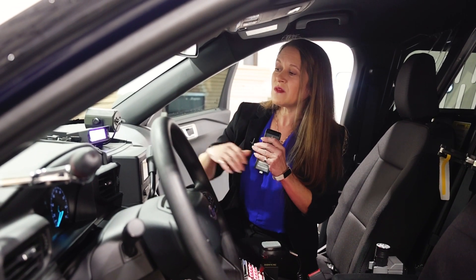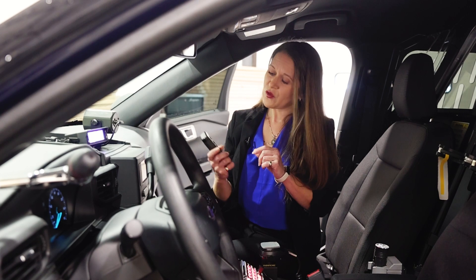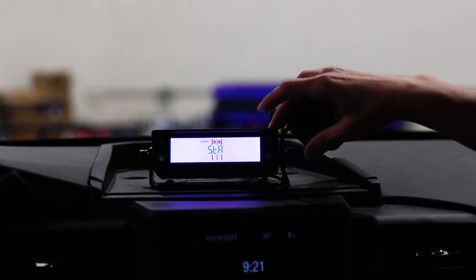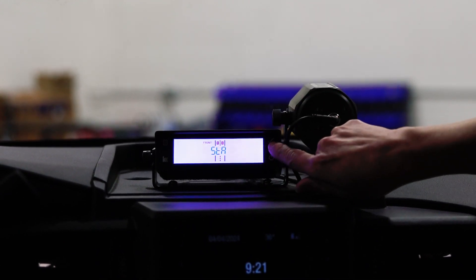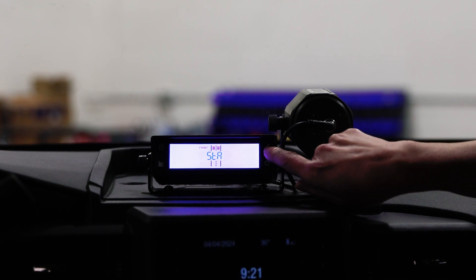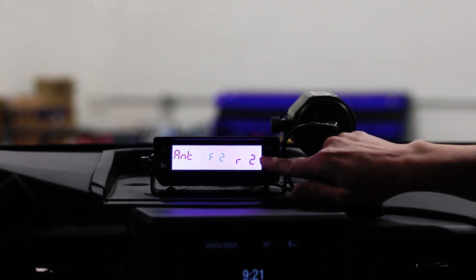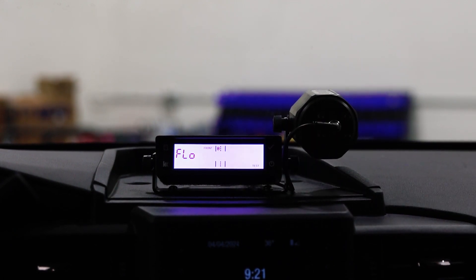However, the Eagle 3 has electronic fork tests. In addition to being able to operate with a metallic fork, we've also made the remote control a signal emitter, so what you end up with is a signal emitted from this remote control that's more accurate and more consistent than what you'll get out of a metallic fork. I'm going to go ahead and prompt for a fork test. This device, whenever it first powers on, immediately prompts for a fork test, but you can initiate one on your own by pressing this check button. When I press it, the device is going to prompt for a front fork — high and low — and then it will prompt for a rear fork — high and low. That 494 is the days of certification left on this device until it needs to be recertified. Now as you can see, it's prompting for a front low fork, so I'm going to send a front low signal.